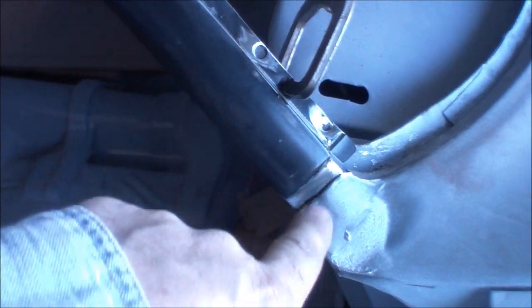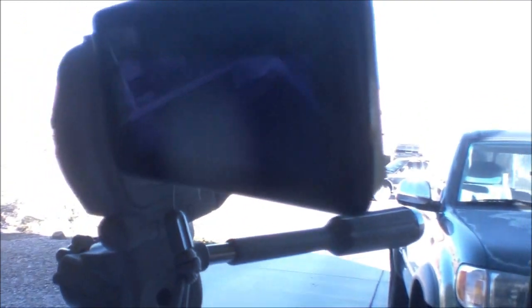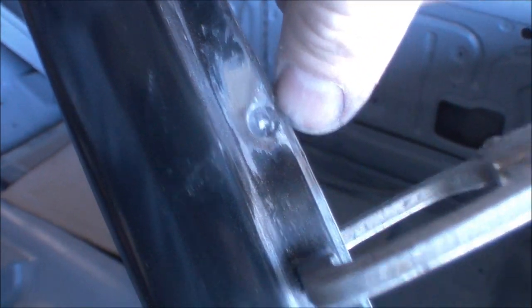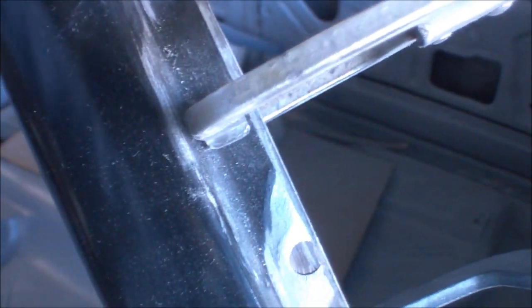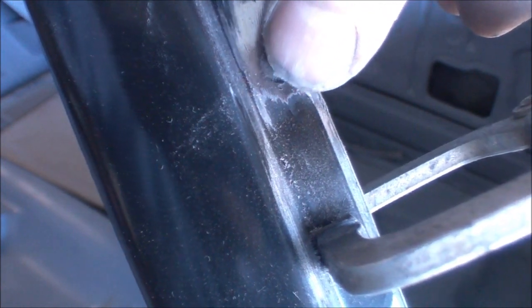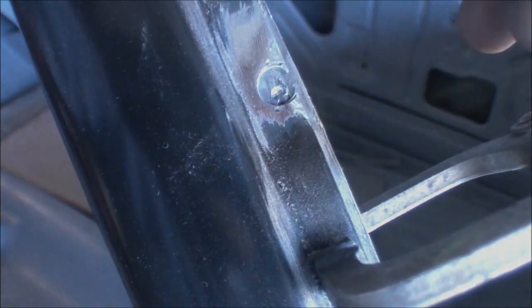This is all cleaned up, at least in the area where it's affected. Our E-coat has been cleaned up around our welds, and we've got auto darkening cam set up. So I've been having pretty good luck. As you can see, my hole punch wouldn't set fully on the flange, and I got a lot of half circles punched. And so I've been having decent luck, kind of like you would weld up a crack, where I'll start up here and then weld into the plug weld hole. So let's get it fired up.